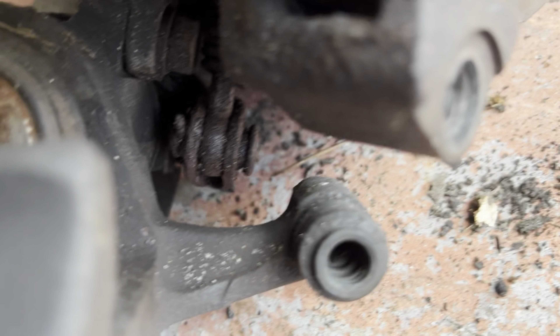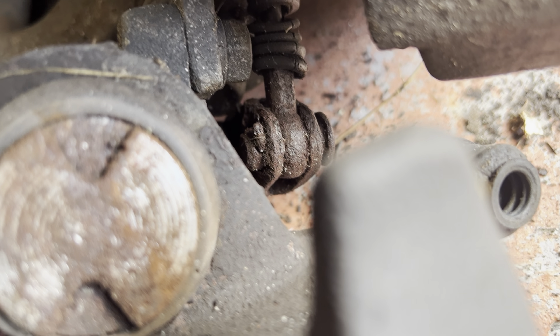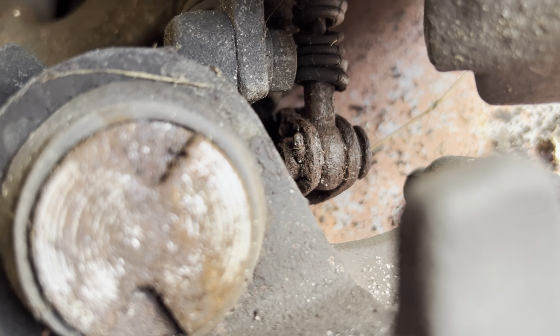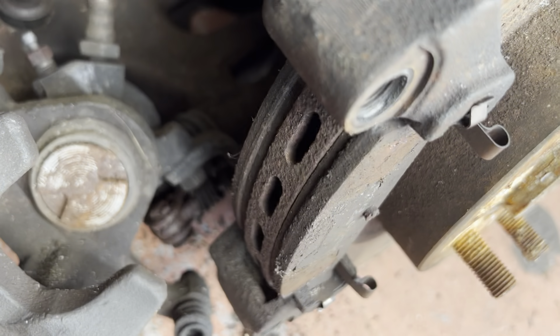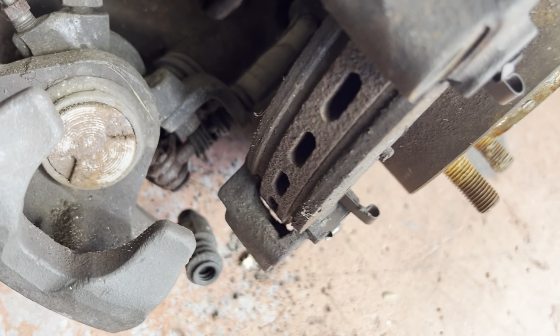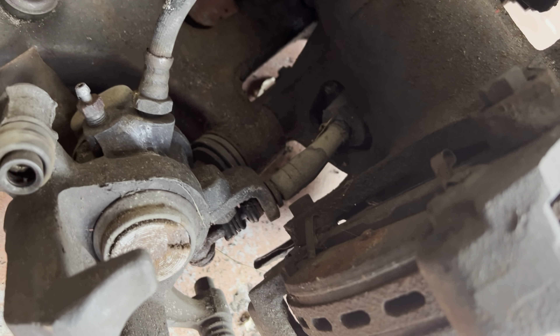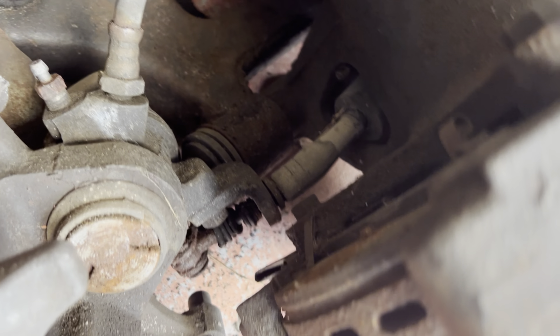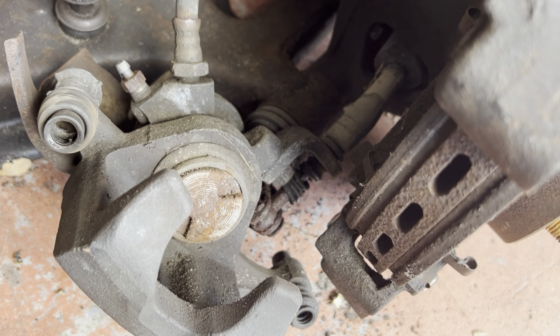Keep track of your bolts. Right down here you can see there's a little cotter pin — take that out, then take your brake cable piece out. Brake pads are here; all of that part's going in the trash. We're going to take loose the bracket right here and we should be good to go.